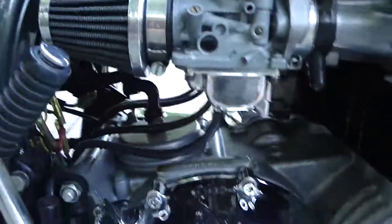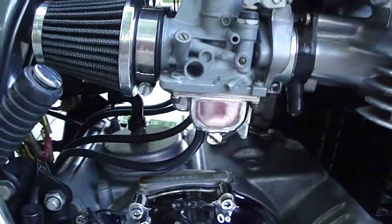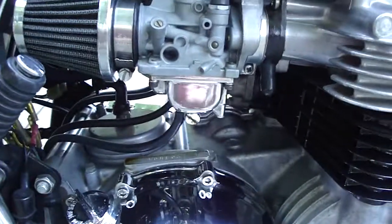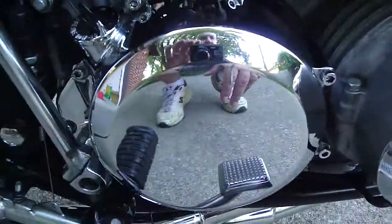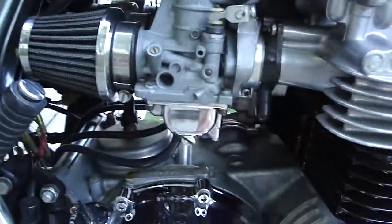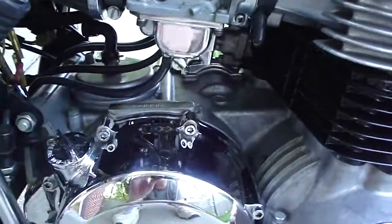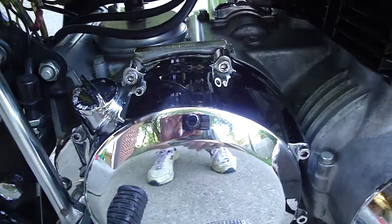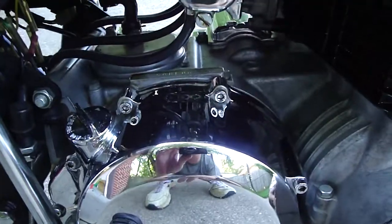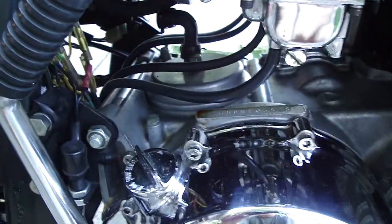and it's just a fact of life with these. I have re-gasketed. I've tried everything I can think of to make these fuel tight, and especially if they've been chromed. Chrome will not seal. It's a problem, and the valve cover on this bike does really well, but I've noticed that a lot of things, especially when you're trying to keep oil or fuel inside and you've got a chrome part, it's difficult, so I wind up taking sandpaper and going over the gasket surfaces to put some tooth in it, because otherwise it's going to leak. But anyway, getting back to the point I was trying to make.